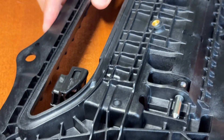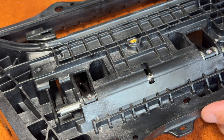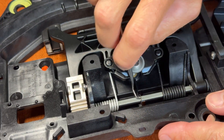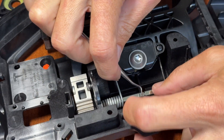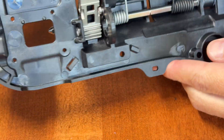Don't attempt to pull the shaft out yet — you have to remove the little c-clip that's hiding down inside the handle. I'll point it out right there. The c is open in my direction, so go to the other side to get a little pick underneath it, place your thumb on top, don't stab your thumb, and pull that c-clip right up and out. A lot of times these will be really rusty if the door handle has been on there a while.